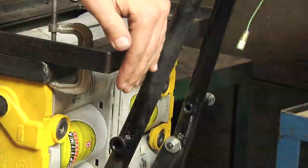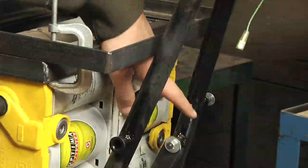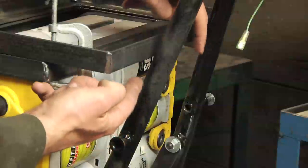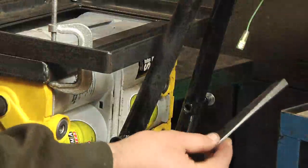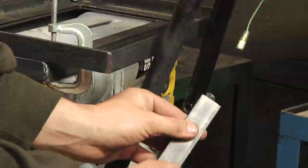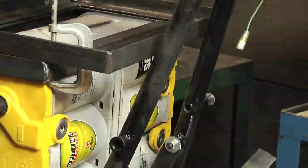To attach the top front of the battery rack to the cycle frame, I'm going to use this attachment right here with some short pieces that come up to the frame. I've got a piece right here, it's just about five inches long, just some flat steel stock, and I cut it — one edge I cut a little tiny bit of an angle because this is going to have just a little bit of an angle to it.